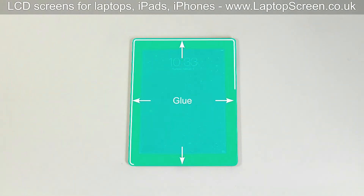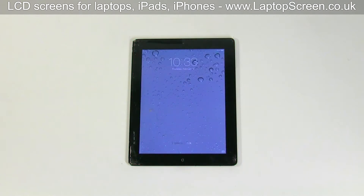The digitizer is glued onto the main body and it is easy to damage the device during the opening process. Before we start removing the digitizer, it is important to know a few zones which require your special attention. The first spot is the Wi-Fi antenna, which is located to the right of the home button. The Wi-Fi antenna is glued to the glass and needs to remain with the main body when the digitizer is separated. Please pay extra attention to that area when opening the device.